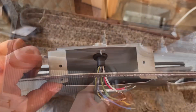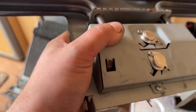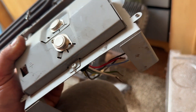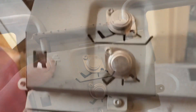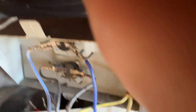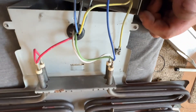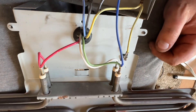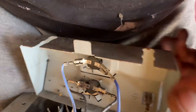So that's it out. I'm probably going to just buy a replacement, but you can diagnose it further now we're at this point. This bottom bit is quite simple — just unscrew that and it should pull out, giving us a better look inside. Hey presto, looks like we found the problem — this is completely gone over time. The heating elements look right; I'll test with a multimeter just to double check. That's the issue there — it's one of these that's failed, so I'll replace both and clean up with some contact spray.